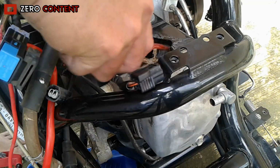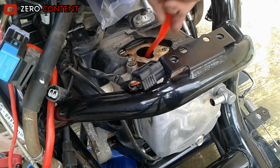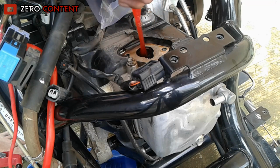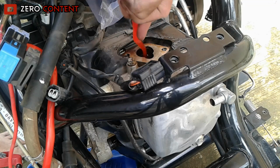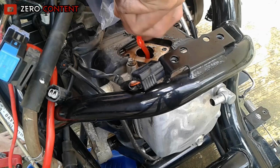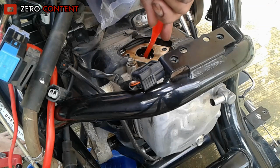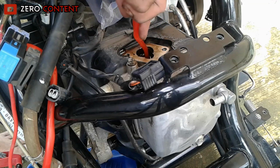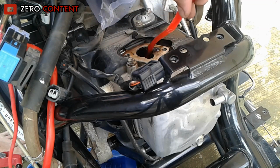After that, rinse the brush and continue to scrub the intake hole. While brushing, add carbon cleaner liquid if it's not enough. When you want to move brushing to the exhaust, fill the intake hole and soak again with liquid carbon cleaner.